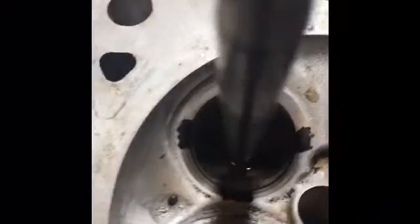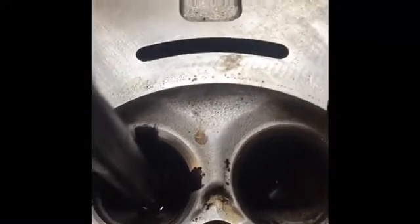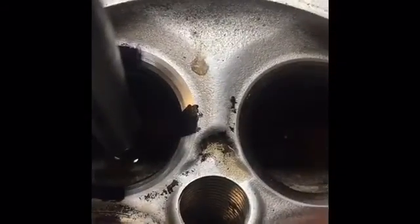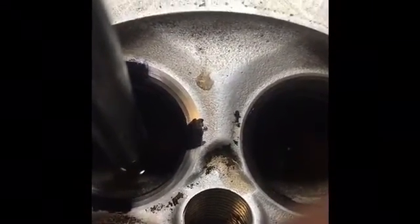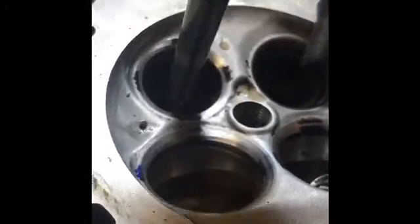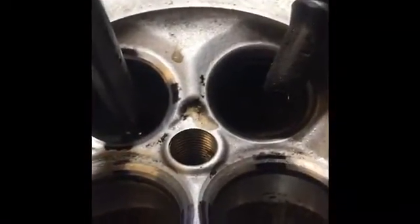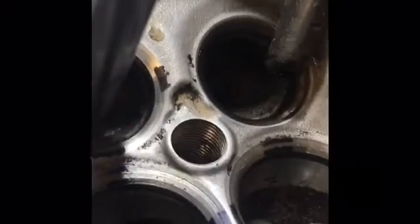Okay, so I went ahead, got the black marker around, and we're going to check for the thickness of our 45-degree surface. Also, if you can see, you can tell we're doing a good job because you can see the 3 defined angles in there. But we're going to go ahead and grab this and make it really defined. So we'll take this and get a good view. Okay, it's decent. Scratch it around a few times, lift up. Lo and behold, our 45-degree surface is now clear and able to be made out.